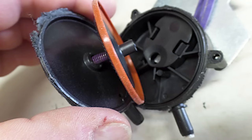On this last picture you can see the diaphragm and what's on either side — the spring on one side and the shaft on the other. When the inducer motor pulls a vacuum or draft, that spring presses down on the shaft, the shaft closes the micro switch, and allows current to flow through. The insides of a pressure switch are actually not that complicated. Thank you for staying till the end — we'll see you next time.